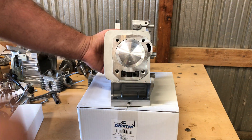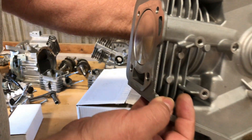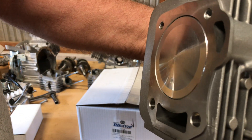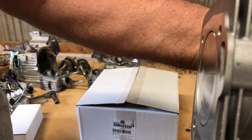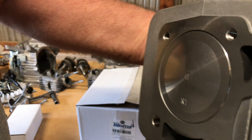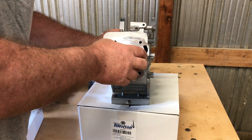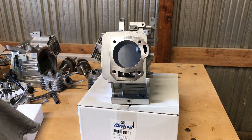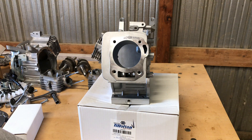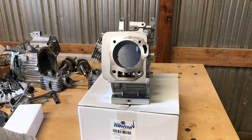This Tillotson block here is the 72mm bore, and this piston looks pretty good. That dome is definitely going to help on the compression. I will have to cut some valve reliefs, but I'm having some tooling made just for that. As soon as it gets here, I'll finish customizing this piston so we can get her together.